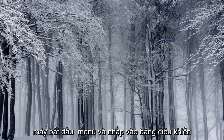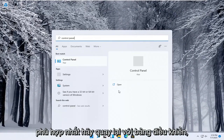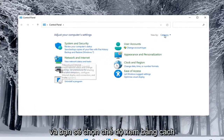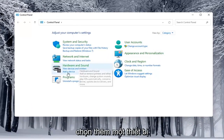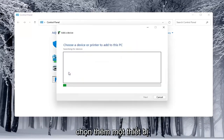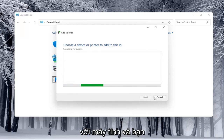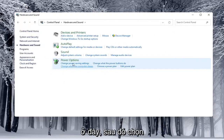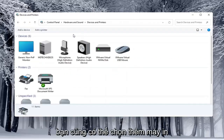Alternatively, you can also open up the Start Menu and type in Control Panel. Best match will come back with Control Panel — go ahead and open that up. You would select View By and select Category View. And underneath Hardware and Sound, you would select Add a Device. Again, you'd see if anything were connected to the computer and walk through those steps. If you open up Hardware and Sound and then select underneath Devices and Printers, go ahead and select that — you can select Add a Printer as well.